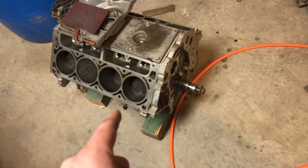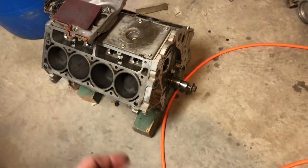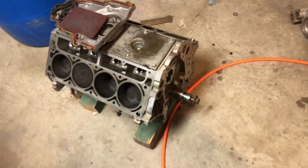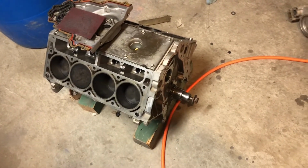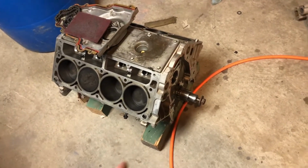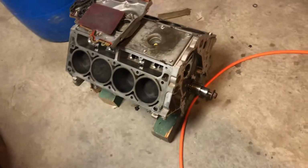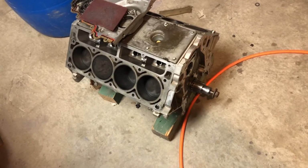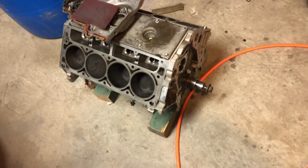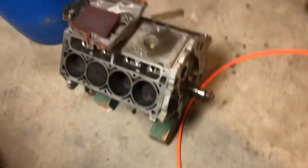Also add the 243 LS6 head, so a little smaller combustion chamber, a little higher flowing. Not so much concerned with the higher flowing, but the smaller combustion chamber I'm definitely excited about, so we'll use those. Bump the compression a little bit, which will give us a little power throughout the RPM range. And yeah, so freaking pumped. We should gain some power.